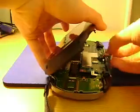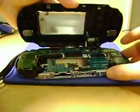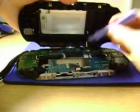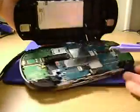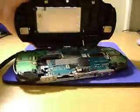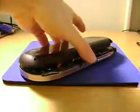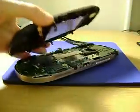If they really didn't want people opening it, then why use Phillips? Exactly. So basically we tilt it open here. There is one tiny little — we tilt it open and there are two ribbon connectors. One for the rear touch panel right in there — you see that silver thing? And one thicker one, like a little Molex for the battery connector. I'll pull off this little one first, and then this one takes a little more negotiation — the battery one — to pry out without damaging anything.